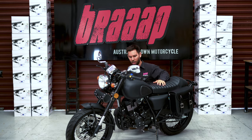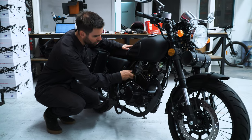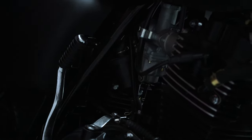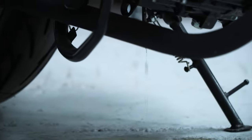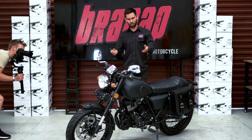Most customers don't have to do this but it's good to know if you're stuck. Grab the screwdriver that's through there, loosen it off, you'll see petrol start to come out the bottom. Let it do that for a minute or two — leave it longer than I've left it here. I'm inside; do it outside somewhere that the petrol's not gonna cause a problem. And that's how you drain your carby.